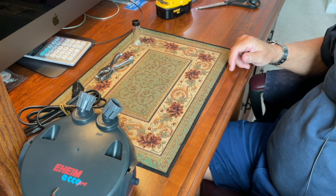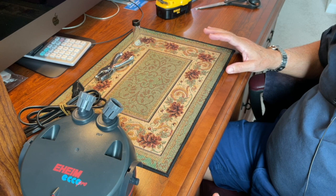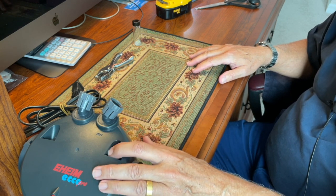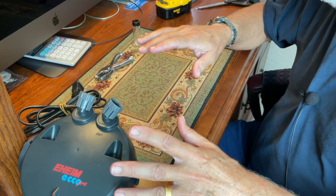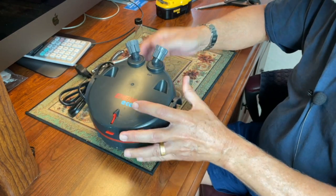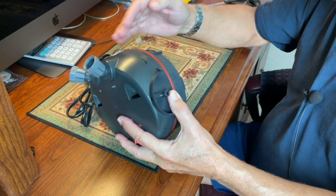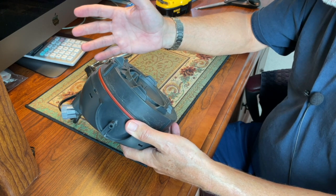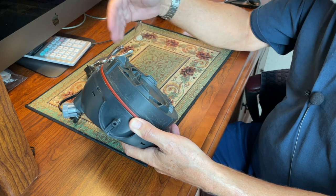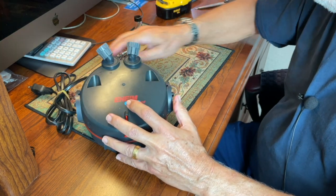I hope this helps you if you're starting to have a little rattling noise in your pump, or even if it's brand new and seems to be making a little noise — don't get mad at the manufacturer. It's just because there are very close tolerances between how all these pumps have to run. If they try to hold the tolerances even closer, the power head is going to get higher and higher in price — it's going to get more expensive as they have to keep putting more time into making the laminations and making everything line up. This is just an injection mold, so your OD and ID are going to be a little off, and tolerances start to stack up. It seems like Eheim holds tighter tolerances than some other manufacturers, which may be why they're a little more expensive.